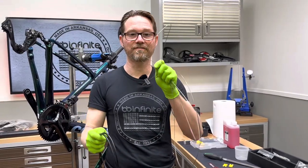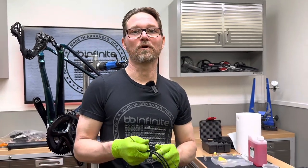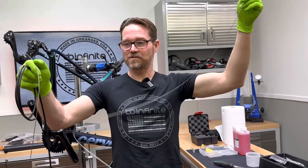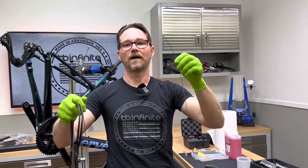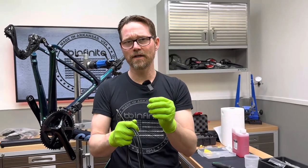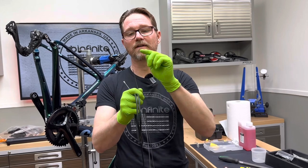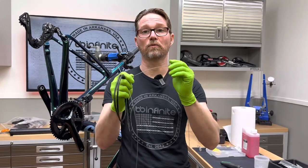In order to get this in there, we need one of these. This ought to be familiar — that is a road bike end for when people used to have mechanical brakes way back in the past. This particular one is super long, which I highly recommend for this once you see what we're going to do. This one is actually for a tandem — highly recommend that. It has to be a brake line. Could you use an inner wire like an SIS? You could, but we want it to be stiff. This is thicker than the SIS wire. We want it to be stiff enough so it doesn't have a tendency to get wrapped around itself.